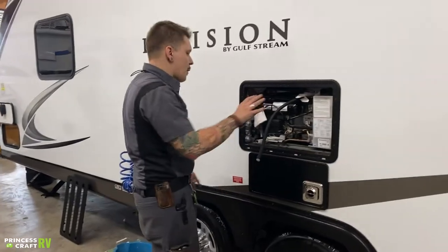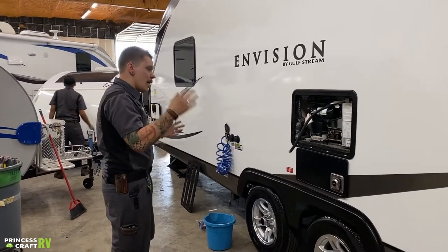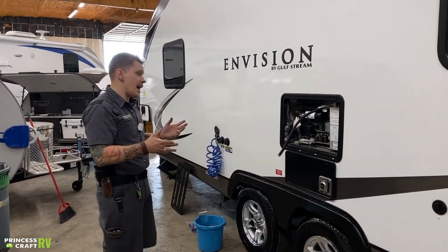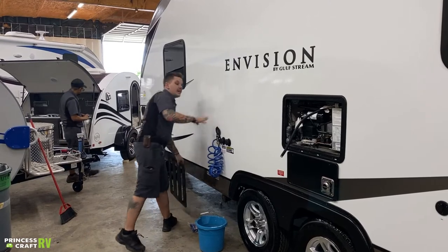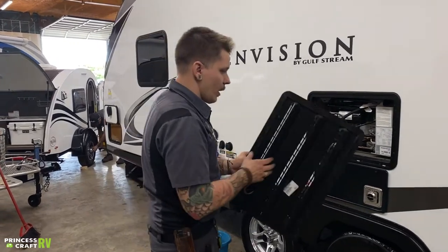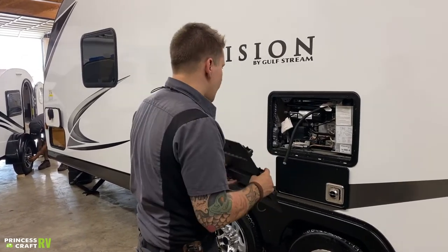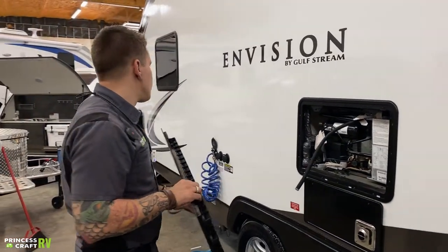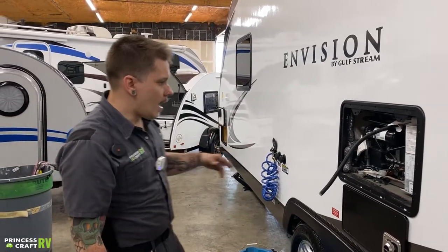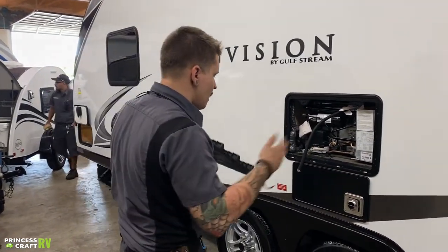We have your refrigerator vent here. From a maintenance standpoint, it's not what we consider a customer-serviceable unit. Most importantly, we need to keep mud daubers and flying insects from nesting within the appliance. We do that by adding secondary screening material to these orifices. Those are specifically cut for the appliance — you can source them from our parts department or DIY something, but they do need to be protected. Remove this vent a couple of times a year, make sure nothing has found its way in, check the wires, and make sure we're not seeing any obvious signs of degradation.